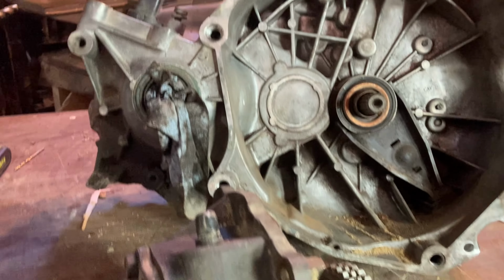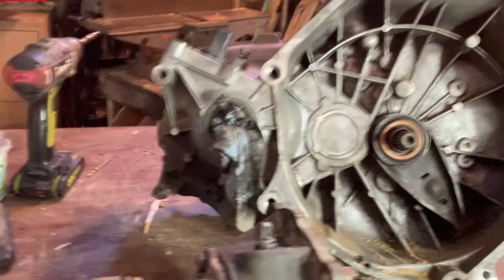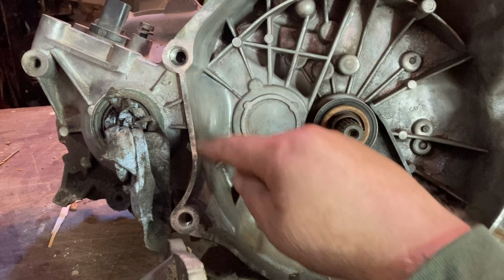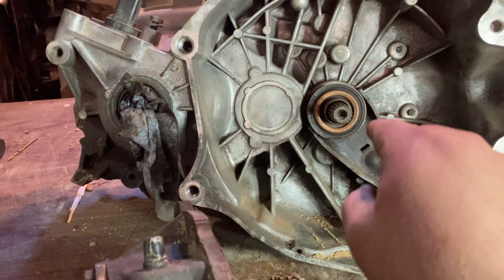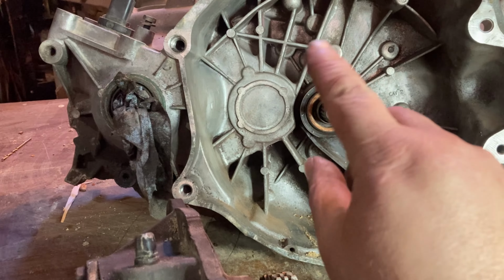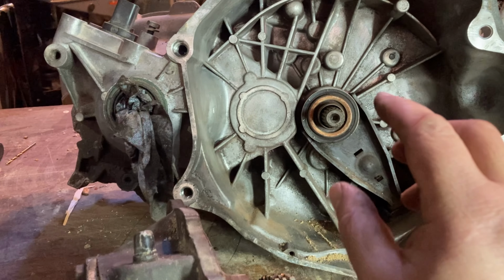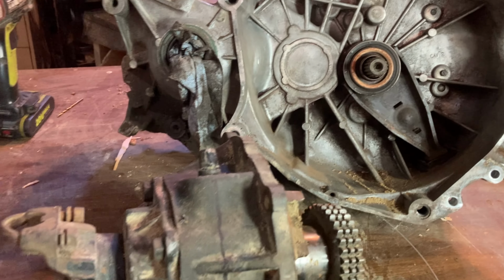Well, we searched around in our piles of ground obtainium because we somehow have to build a plate that goes across here with a bearing to support the clutch and the flywheel inside here. We have to have a shaft coming off of that clutch and flywheel that will power off of the sprocket that turns the chain on the GSXR engine. Okay, everybody following along so far? That's good, because this is probably going to be a little bit confusing until you see what's going on here.